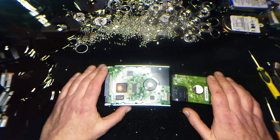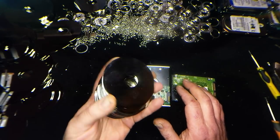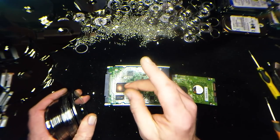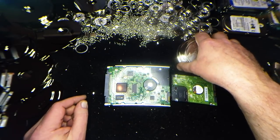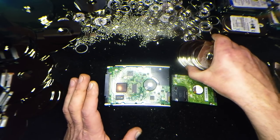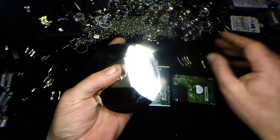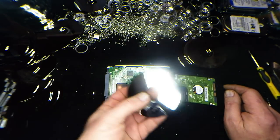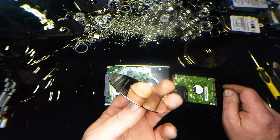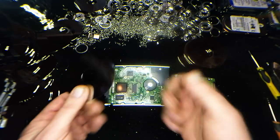So what else can I say? If you go out and buy a whole stock of platters, I guarantee that the majority are going to be just the old ones. But if you're scrapping them out yourself, I suggest starting at 120 gigabytes. Anything above 120 gigabytes, put them to precious metal recovery for platinum. Anything under 120 gigabytes, put them as just aluminium and you can sell them as art material or just throw them into your aluminium. I'd imagine only one, two, or three percent of hard drive platters actually have any platinum unless you go with the really old big chunky hard drives.